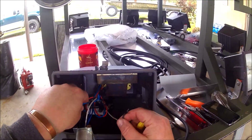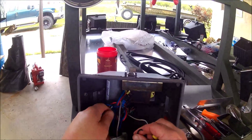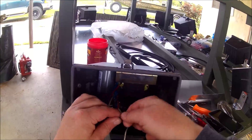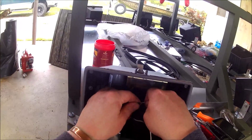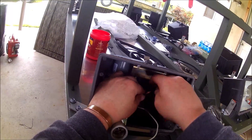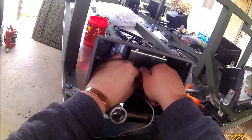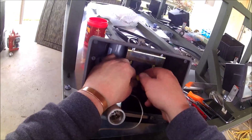Now that you have the one remaining wire from the igniter, you need any of the two legs from the capacitor - they're both the same color, they're blue, it doesn't matter. You twist those two together, and then you need the black power leg coming in off your power. You could actually reverse these two and it wouldn't matter either, but for the sake of keeping things uniform, black to black. Simply screw on that wire nut until it's tight. Boom - good to go.